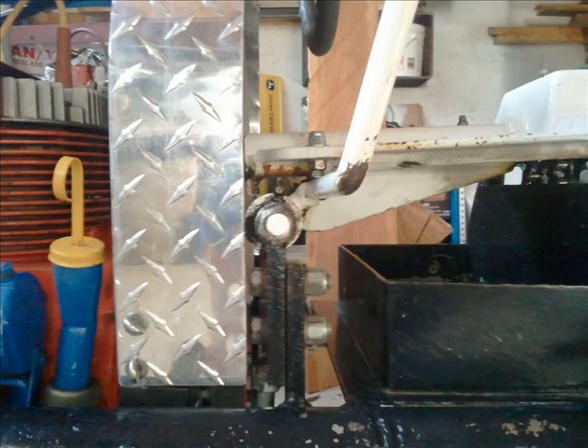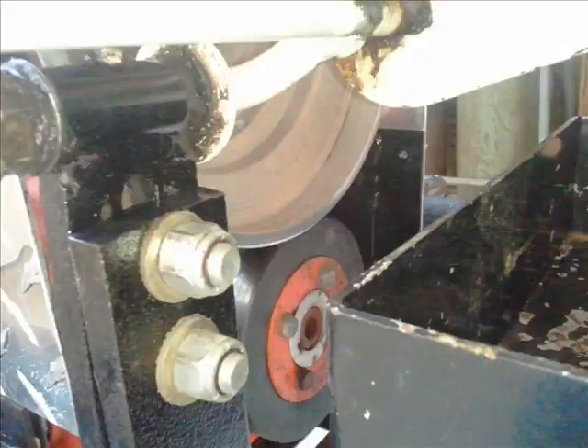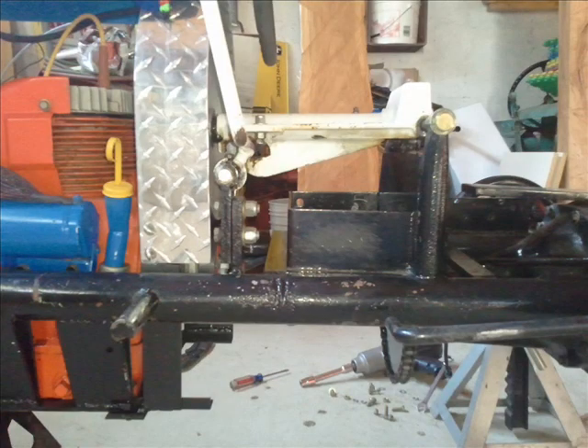When you pull it back, it pushes down on the casting and makes contact. There's an aluminum pulley attached to the jackshaft that makes contact with the rubber puck on the engine, and that makes it spin backwards. Here's an overview of what that looks like.